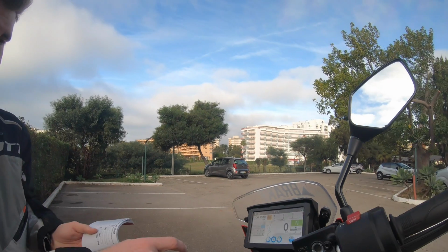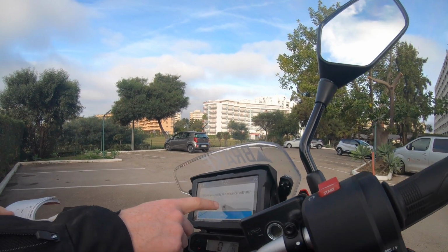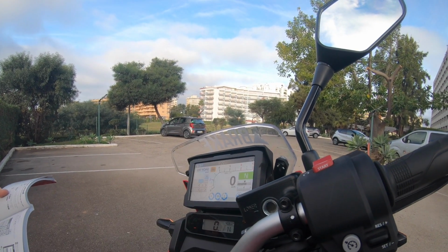But on the Honda, I generally found myself turning it off a bit sooner than I probably would on those bikes. The ABS, you can only turn off on the rear wheel. And I think Honda have done a really good job of improving the ABS, but it suffers a little bit from the same problem. It kicks in a little bit early, and for me, it kicks in a little bit too much. So I always found myself kind of riding with a bit more in reserve, just in case that ABS did something I wasn't expecting it to.